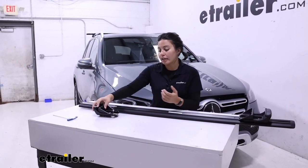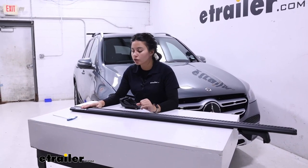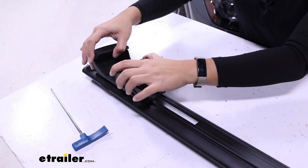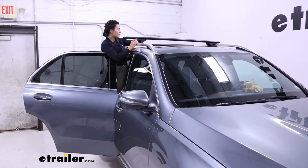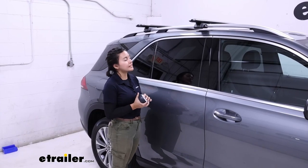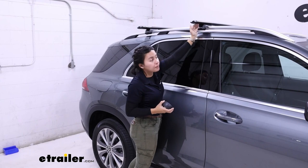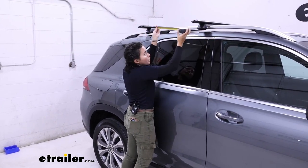Installing this crossbar is a lot easier compared to other styles because a raised rail roof rack is very simple. First, set up your crossbar — you'll have a spot for vortex strips, so push those in and get the towers on. Put the tower into the clamped position so you can slide it through the bottom, then open that back up and put it onto your raised rails. Positioning depends on what you're carrying — I want it a little further back for more clearance for the window up top. One measurement you get is the crossbar spread, measured from one crossbar to another. Center to center here we're 28 inches apart. Some people want it further forward so they can open the hatch if carrying a roof box. Once you've figured out your crossbar spread, make sure it's the same on the other side.